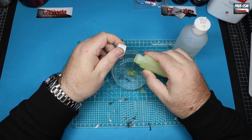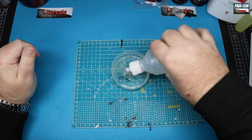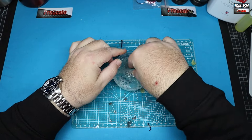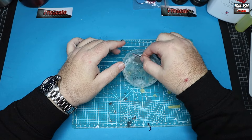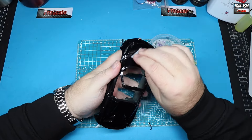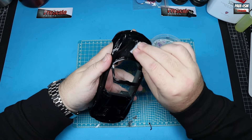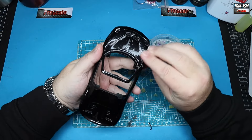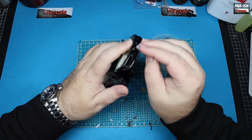We've got a bit of wash and wax liquid and some fresh water mixed together. We've got our 3M Trizac pads - the 3000, 6000, and 8000 grit pads - which we're wringing out and getting full of nice soapy water. What we're going to do is flat back all the bodywork. A lot of people are asking about polishing techniques and this is quite new to me - well, this wet sanding step isn't, I do this all the time, but the polishing techniques with the rotary tool and the new compound is a little bit different. I did it on the Porsche and I'm going to do it on this one.